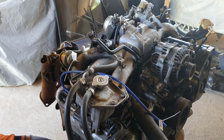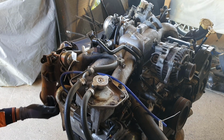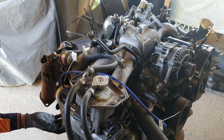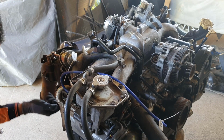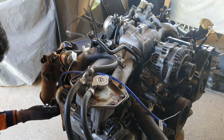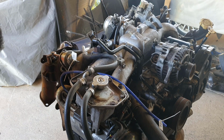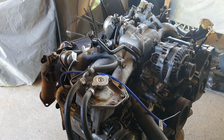Basically, from the up pipe that comes from the headers or the exhaust manifolds at the bottom up to the turbo, the heat shield on it only has a tiny couple of spot welds that hold it on, and those spot welds break with vibrations and then they rattle. It's very common for cars to come in with a strange rattling noise in the exhaust that you can't quite pinpoint. When it's in the car, it's not so easy to get at.